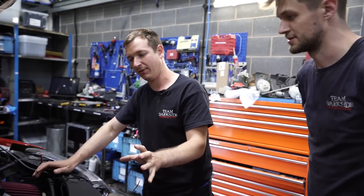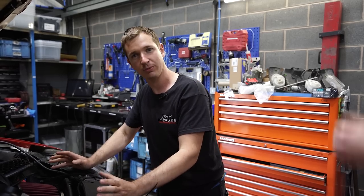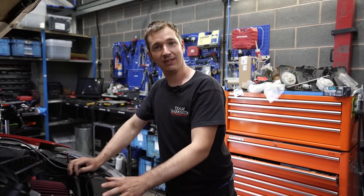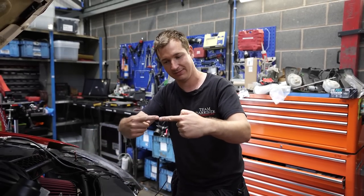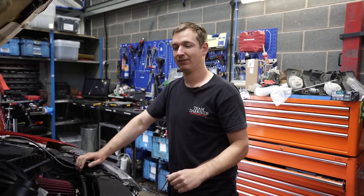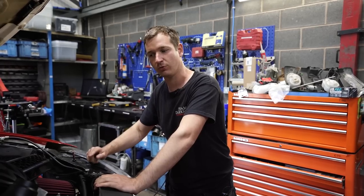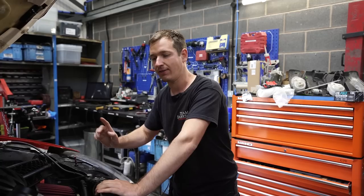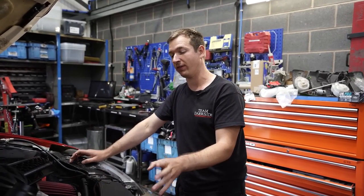Right. So basically what Paul did, he messed up, bleep that out. So he fixed it. So basically we've got water just going like this. That's not good. We needed it to go in and out. Now it does. And the oil temps, I think we've had it on the dyno since. Yeah. We've had the coolant up to 105, which it never got past 90 on the track, and I think 91. And the oil was like 8 to 10 degrees hotter than that, and that's as hot as it got. So we're confident we've sorted that.